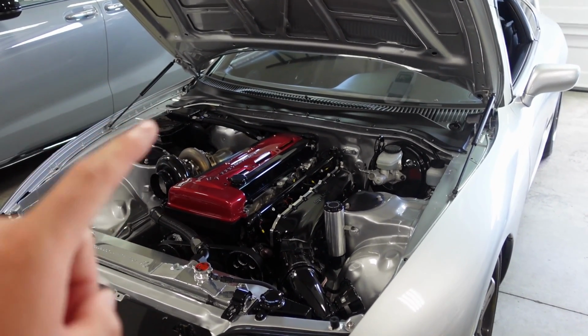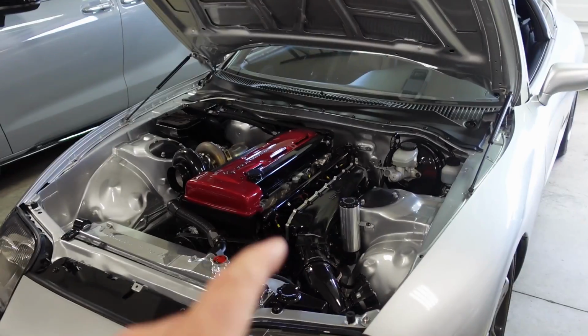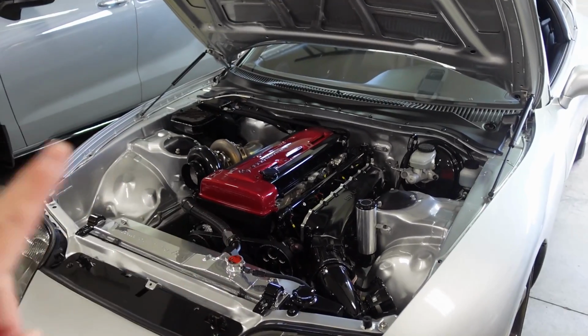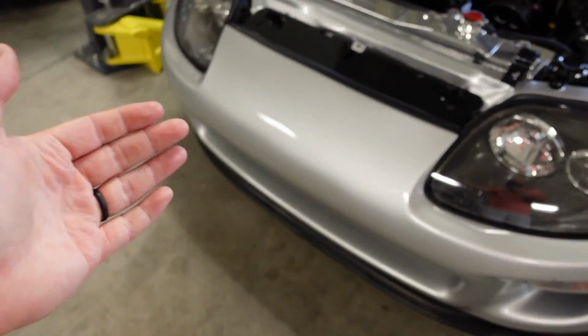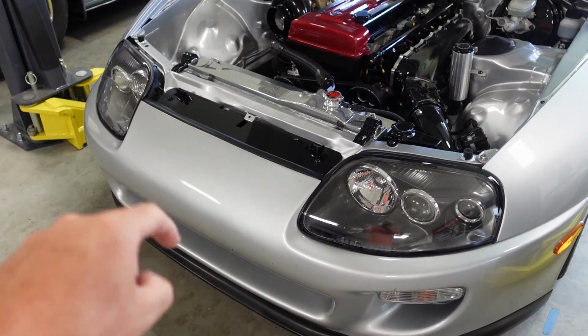The only issue with it is the push on, push off works, and it'll stay latched the whole time, and it doesn't affect the off button. But if I hit that off button for data logging right now, and the other button's being used, it'll automatically kick it off, because when you hit the off, it automatically pops that latch button up. Obviously, it was never designed for this. It was meant for the front spoiler to go up and down. Meant for auto on, auto up, or to automatically just push it on and off.